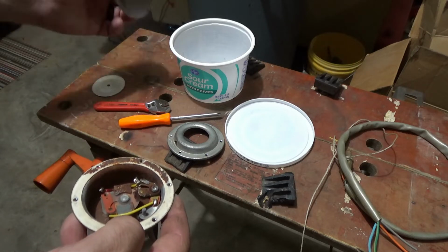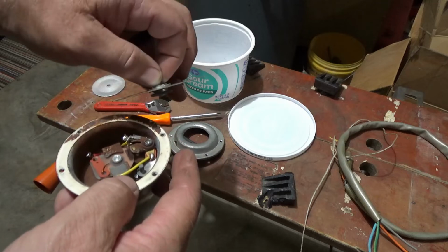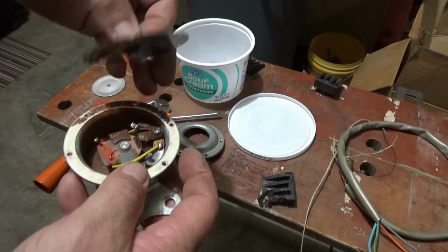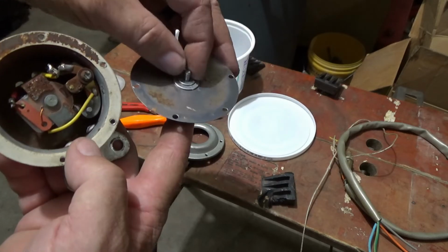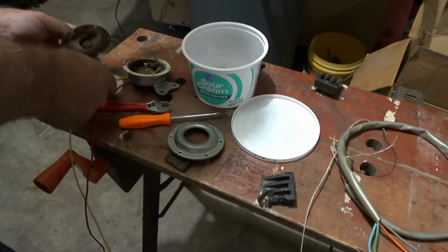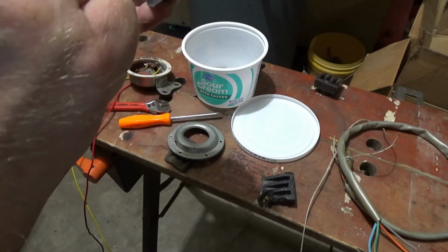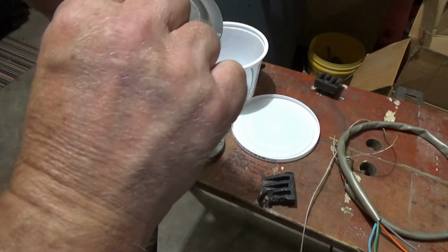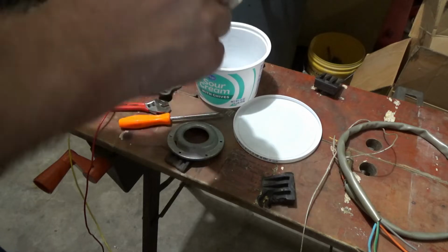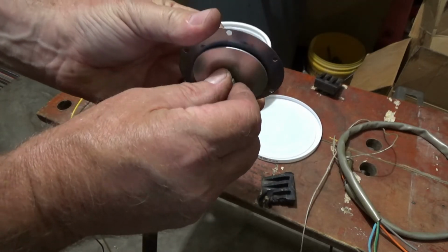So when I took it apart, I had no idea. I took all these screws loose, and then I took this centerpiece, this nut loose, and these, and then lifted this off, peeled this loose from here. But I didn't have to take this apart, so I'm just going to go ahead and put that back together real quick. And this goes, I think it goes the little bevel down, I believe, and a washer, and then this nut. And I did not have to take this off. I could have just pulled this baffle and whole assembly out.